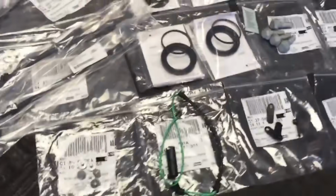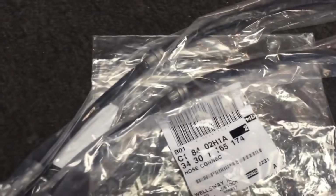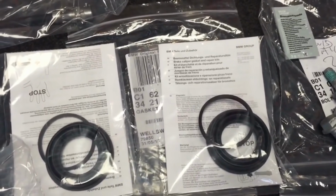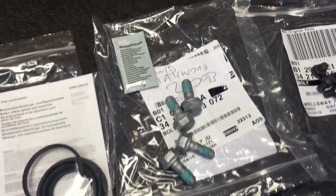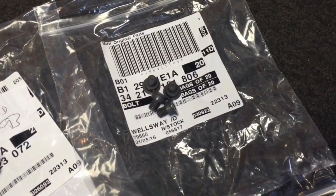These are the items for the brake caliper systems on the M3 CSL. So we've got rear BMW rubber flexible hoses, the rear CSL caliper piston kits, and the CSL rear calipers are unique because they have a larger piston. We've got the rear bolts there that hold the caliper carrier to the hubs, and some BMW brake paste, along with the 4 bolts to hold the grub screws to hold the discs to the hubs.